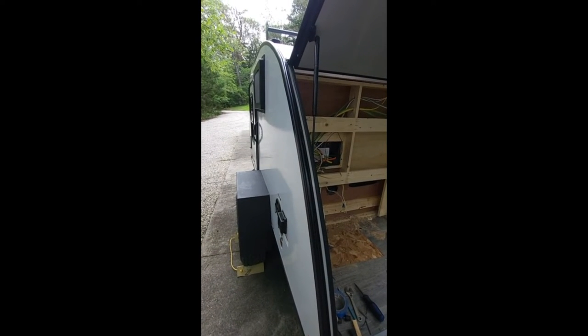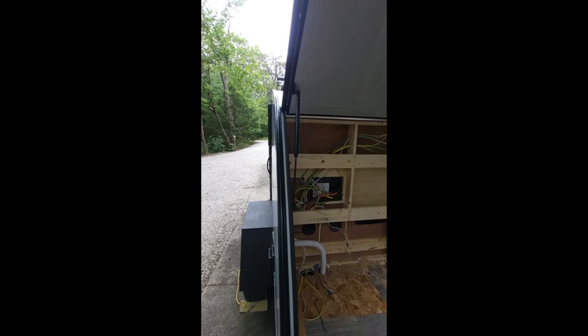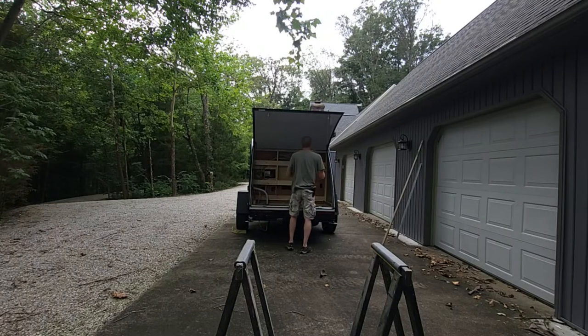Let me get started removing the door — I've got some padded sawhorses set up that we're going to set the door on to work on it. We're going to remove those two stop screws first and then remove the clips on these gas struts right up here at the hinge points on the top on both sides, and then just slide this door to the left the full width of the hurricane hinge and then the door will come free. Against my better judgment I decided to go ahead and let the camera run while I remove this door — that way if things go really bad we might have a good blooper video out of this. To remove this door there are these clips on these struts that you can just take a knife or a screwdriver and remove, leaving the strut in place while you do that.